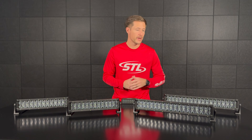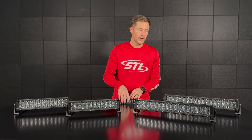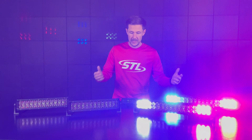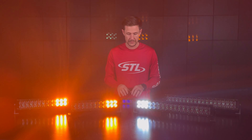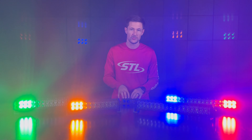Moving over here, we have our 20 inch model. I brought a red blue version and then a red clear version, and you will notice that both of my light bars are on different flash patterns. Each of these light bars will come with multiple flash patterns programmed in them. You can easily change your flash pattern by using your yellow flash pattern cable, which I went ahead and hooked up to my F switch — a momentary switch on my six switch box.